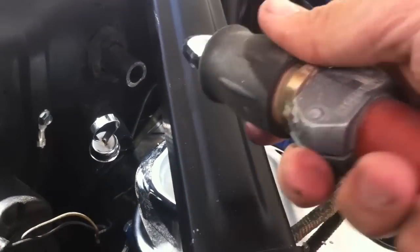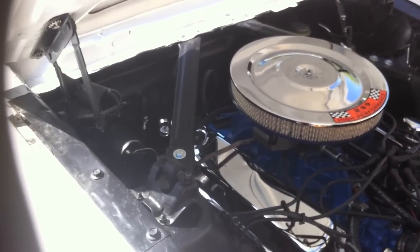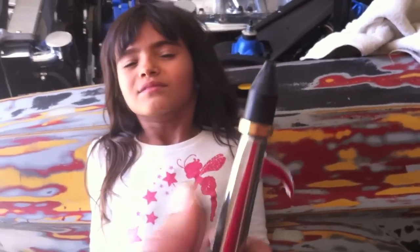Here's the hose — I'm basically just going to blow water straight through that line down there. Sorry for the one-handed operation. There it is — see all that antifreeze coming out? Now it's clean water. One more time. So that's just putting water through it — it's very much like a little radiator in there. She's been flushed of antifreeze, and now we're going to blast it with compressed air to get the water out.